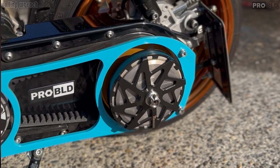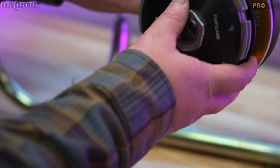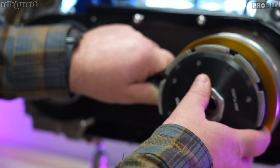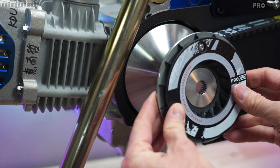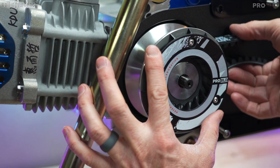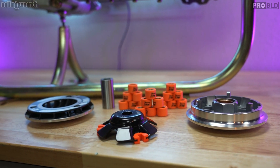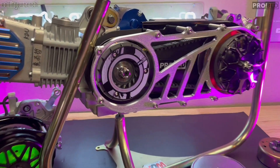One of the main reasons why we have these high horsepower numbers is because of our Ultimate CVT Kit. It comes with a non-traditional super lightweight Ravino clutch, our ProBuild Ravino Variator, 842-2030 Kevlar Belt, and TFC Lightweight Drive Pulley. The whole thing is way lighter than any stock GY6 or aftermarket GY6 stuff outside of Ravino, and I'm going to install that in this episode.